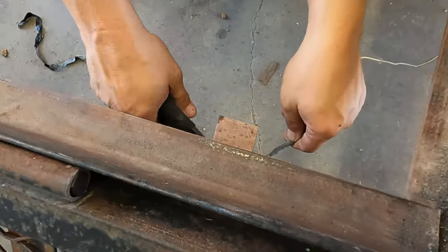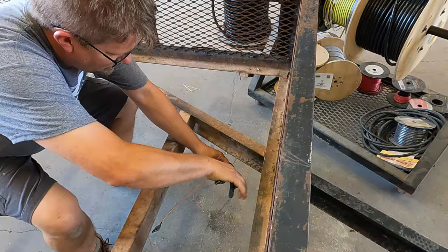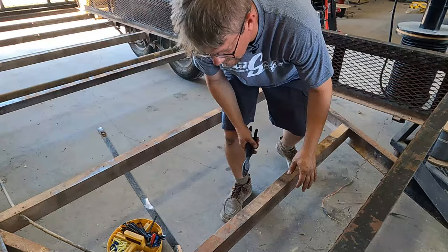Say no to scotch locks — we will go back with butt connectors. We have a trailer in here that we are going to re-floor. While we have the floor out, let's go ahead and clean the wiring up, making repairs as needed. It's much easier to wire with no floor in it. We're going to rip all this old junky wiring out of here, replace some of the connectors, and then reinstall with some new wiring.